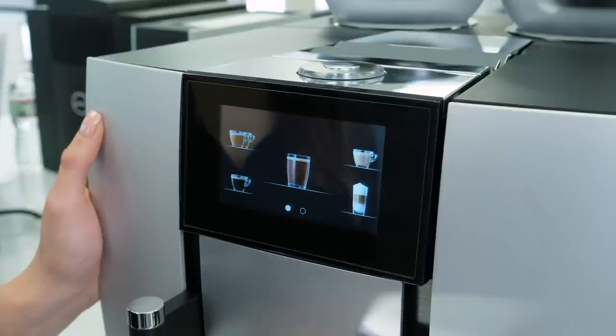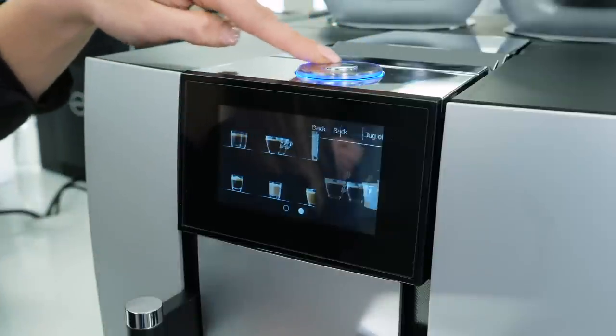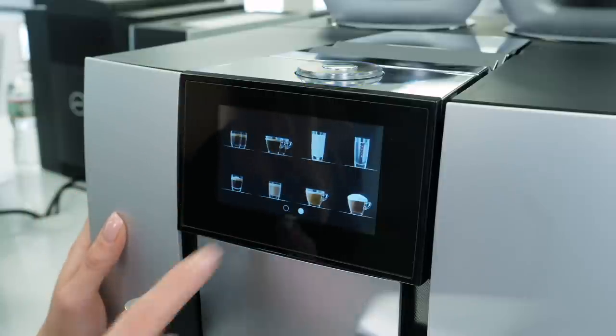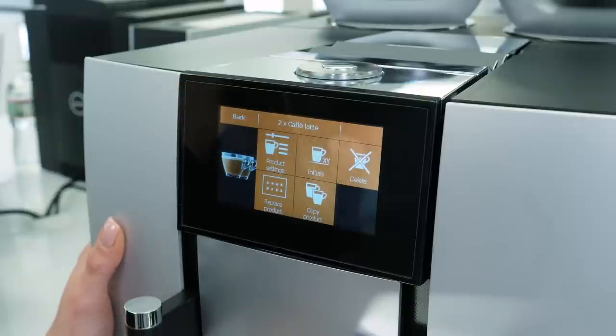Those are gorgeous. Let's take us through this touchscreen. Everything is fully programmable right from my screen. Not only do I have two screens on which I can select my beverages, there is also a blue crystal rotary at the top which allows me to find a library with additional beverages. If I want to program a beverage, I simply hit the back button, then press and hold my cafe latte to enter product settings. In the screen, not only can I change the product settings, I can also replace the product, copy the product, change the initials, as well as delete from my screen. The Giga 6 has a super premium feature called customize and duplicate, which means I can have variable recipes — for example, an AM one with regular beans and an evening one with decaf beans.